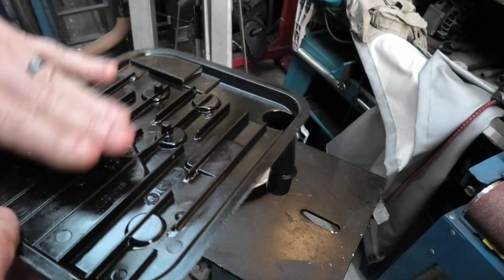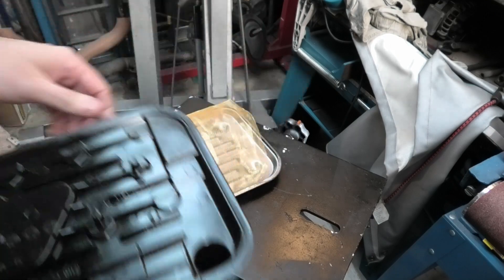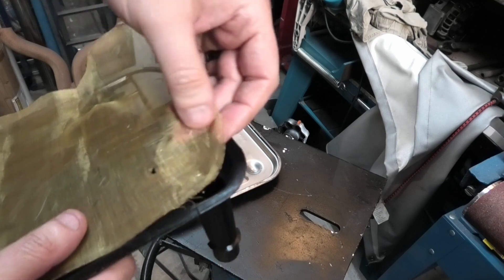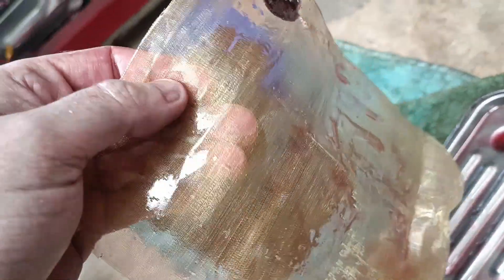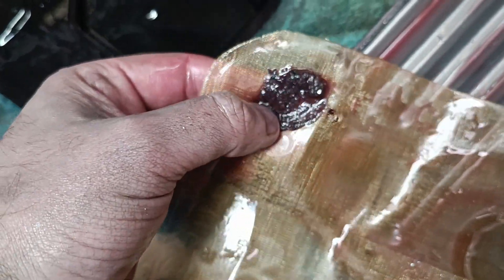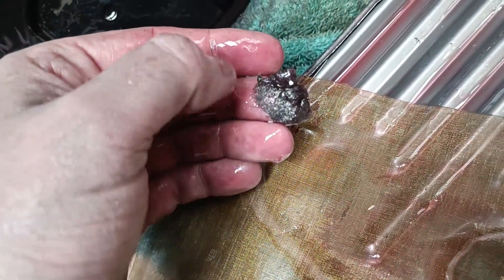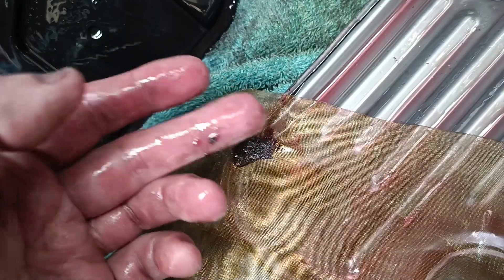The standard base has some corrugations which will keep a rigid filter material off it, but it's not going to work with something as flimsy as this. It'll do a little bit, but you can see by the indentation — there was an indentation in that spot. I'll splice in a bit of video from my discovery where you can actually see the accumulation of dirt on that spot. And I'm not talking a lot of dirt — a very small amount, just some kind of fabric material, probably from a rag, that would have just got chopped up and moved on somewhere else in the transmission.